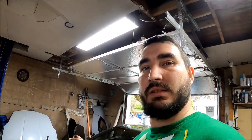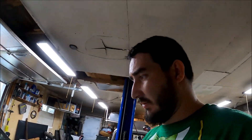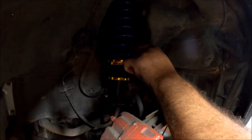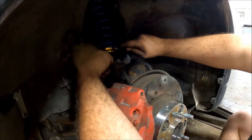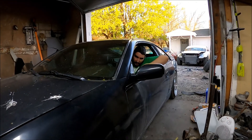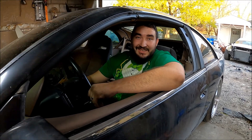All righty, so I had to go and raise the car up about an inch — it was just rubbing too much. I took it for a test drive and the right side is still rubbing, so I'm going to lift it up and re-adjust the coilover one more time. These two are tight so it's just spinning, not tightening up the spring. You can just go like that and that turns this whole thing right here, which pushes that up. I raised the front of the car about two inches — if it rubs now I'll be pretty stressed out.